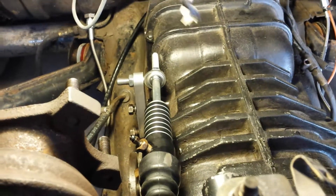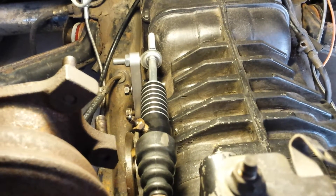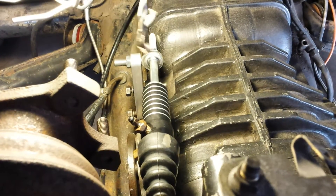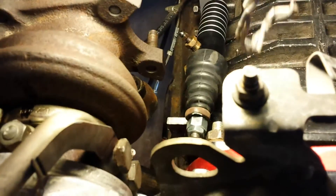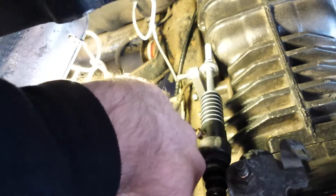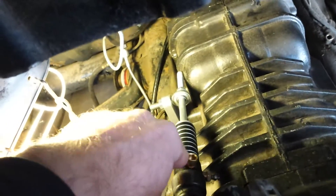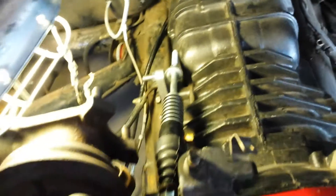I've got the Pacific Customs slave cylinder bracket on there, and I ran the heim joint on the inside of the transmission — well, close to the transmission, not on the outside, which is where it was. So I had it over here and now it's here. I've got extra clearance now. As you can see, the turbo hot side and everything is very close to the clutch, so I plan on building a heat shield to come up here and protect this rubber boot and the slave cylinder itself. And I plan on running the slave line on the inside here to get it away from the turbo.